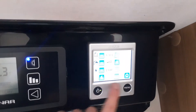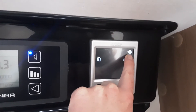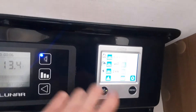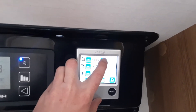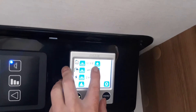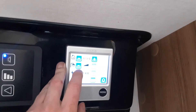Once you've filled the water system you can go to the heating and hot water controls. Press the menu button on the bottom right hand side. This is your home screen, bringing up the internal temperature of the caravan and showing that mains power is coming into the van. When your heating pump is on it will come up with an icon that looks like two arrows chasing each other on the top left hand side. To turn the heating up press the arrow plus, or to turn it down press minus. For water heating, this is the second icon down — the water symbol. You've got water heating on and water heating boost; boost is when the bar is completely full of colour.